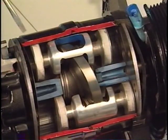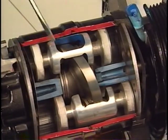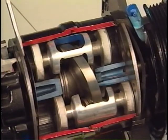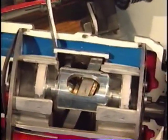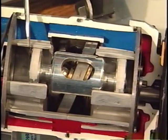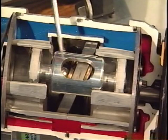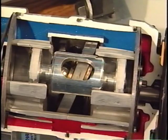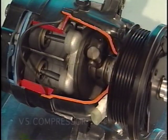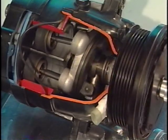From 1983 through 1993, General Motors used the DA-6 and HR-6 compressor, which had a suction side reed plate against the discharge reed plate in the rear and the front of the compressor. In 1994, they went to the HD-6 compressor that had the reed plate at the end of the piston. The refrigerant came in through the low side into the center of the compressor, sucked in through the low side at the end of the compressor, which made for smoother and quieter operation. On the cutaway version, you can clearly see the wobble plate that varies the stroke of the five pistons to match the required compression capacity.